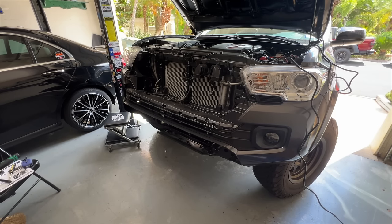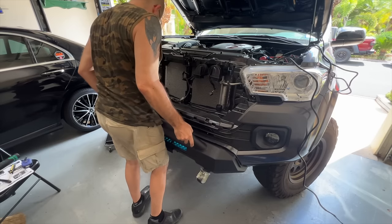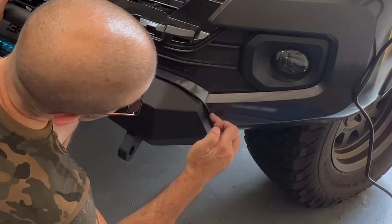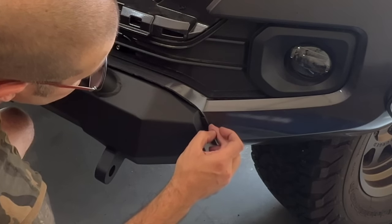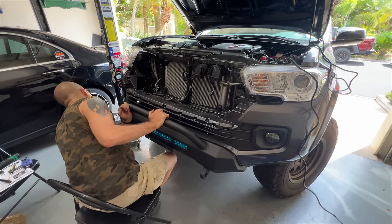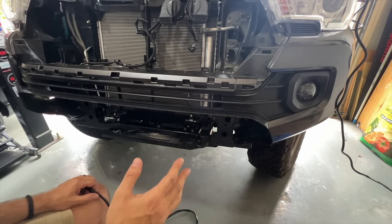Now I'm going to grab this heavy thing and see if my cut was any good — if it fits — before I put the weather stripping on, because I may need to cut more. It's on. How does it fit on the sides? It's a little bit off — it can be trimmed just a little bit on each side, starting from this nub and taking out a small sliver. I made a couple more little adjustment cuts and I think the cut was pretty good overall. We're going to go with the way it is.